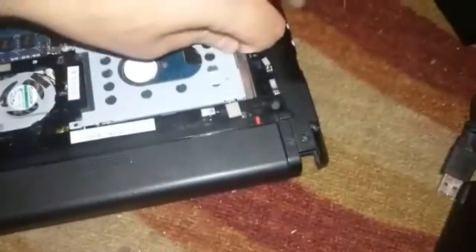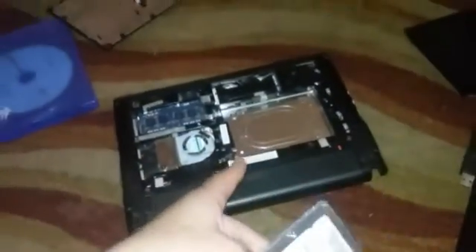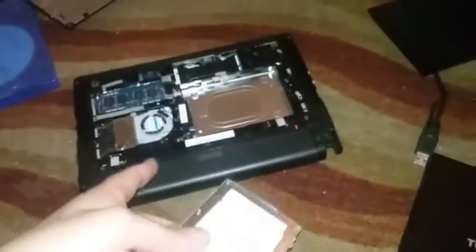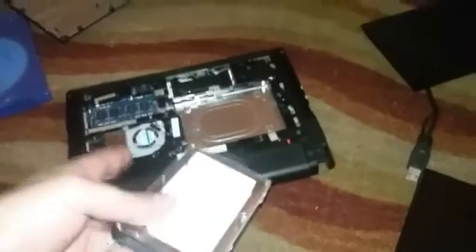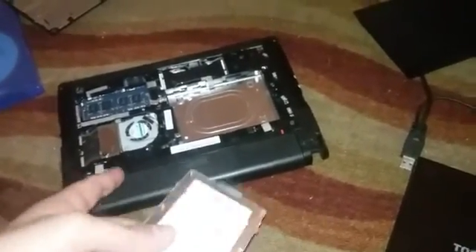For this one, you have to do the same thing. All you need to do is make sure you have a flap — you can actually use your screwdriver to lift up a back flap. Lift it backwards, go up, and you get the hard drive released. And all models are different, so if you're trying to disassemble your computer just to switch the hard drive, be sure to look at ifixit.com — I'll leave that link in the description. And if you're doing this with your parents, please have their permission before doing this.